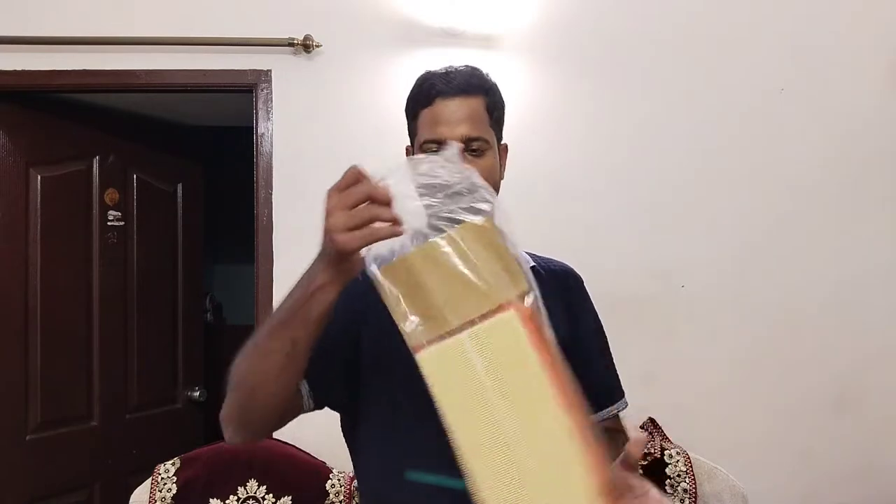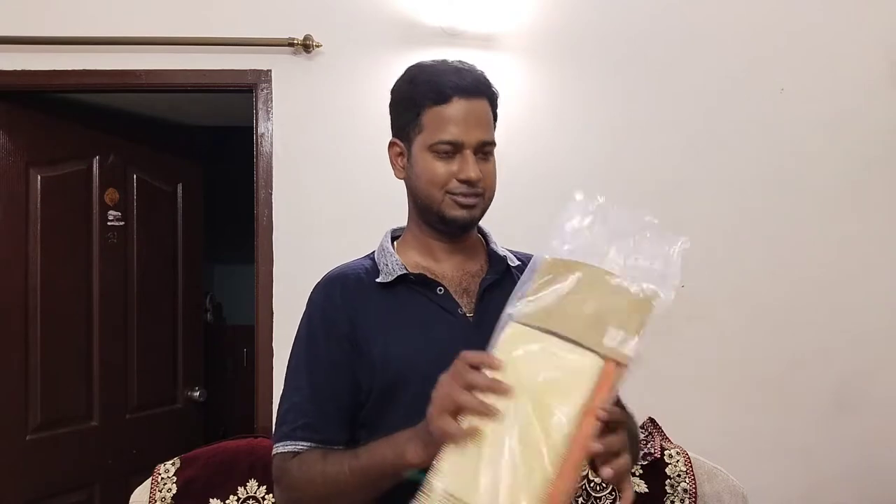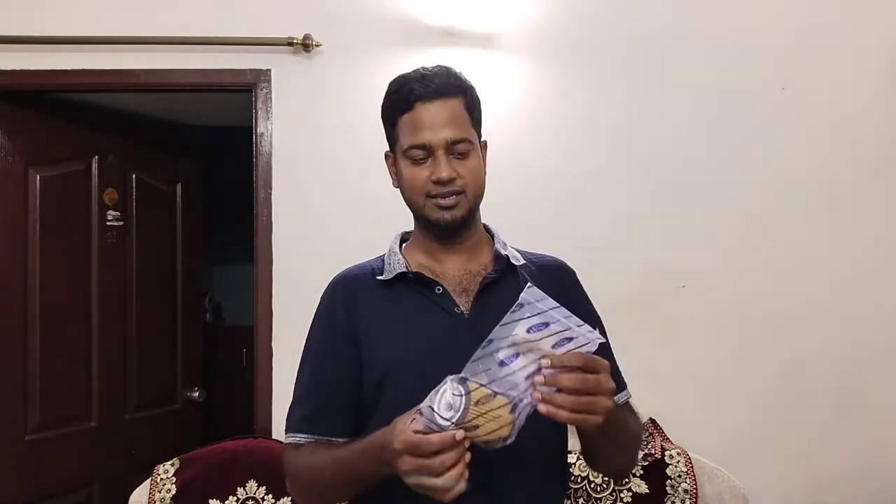This model has a fairly large air filter and the box is completely unopened — we'll open it while changing. The third item is the oil filter — same Ford OEM oil filter. Also included is the drain plug, which we change during every service. The tools required for the whole process are a 21mm hex socket to remove the drain plug and a 27mm hex socket to remove the oil filter. Now let's get into the live demo.